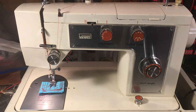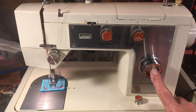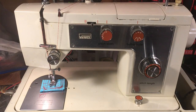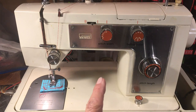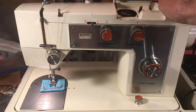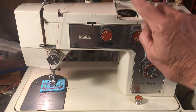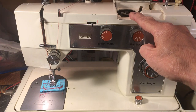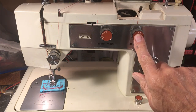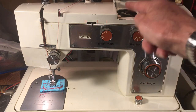I don't know how long it's been out of whack, but now it is back in fine fettle and it's sewing like a house of fire. Tension's on four, the bobbin winder works, everything's the way it needs to be. Now this one comes with a zigzag cam, which this one does not have. There were screws missing up here on this lid — I had to put spacers on there to get it to close. But without a zigzag cam in this model, it is a straight stitch only. You'll still have your three-needle position, and you won't have a buttonhole — you'll have a straight stitch and a double needle.